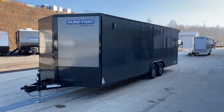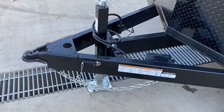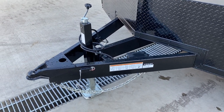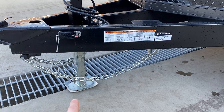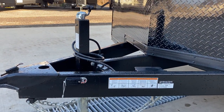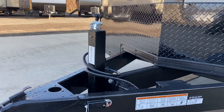Other than the blackout package and at the rear of the trailer the spoiler and scene lights, everything else here is standard equipment. Starting up front, it's a two-and-five-sixteenth inch ball coupler. Instead of the traditional A-frame jack, this has the setback jack — and it's a 7,000-pound drop leg jack. It has an inner sleeve that adjusts via the pin, giving you a lot of travel, and the top-line handle adjusts the outer sleeve for even more travel. No need to carry around wood blocking to get disconnected.